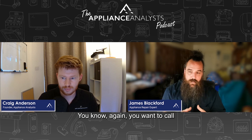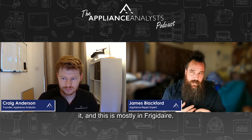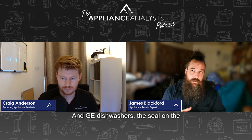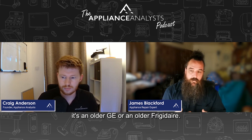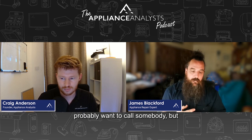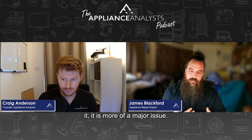Again, you want to call somebody because that's kind of a pain in the butt repair. The other thing that could be causing it, and this is mostly in Frigidaire and GE dishwashers, is that the seal on the motor can actually leak, especially if it's an older GE or an older Frigidaire. Again, in that situation, you probably want to call somebody. But unfortunately, most of the time when it's seeping out from underneath, it is more of a major issue.